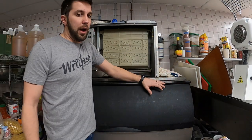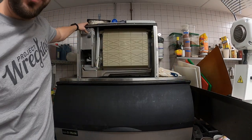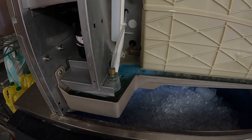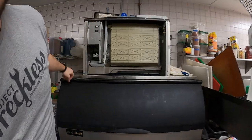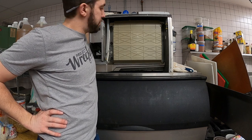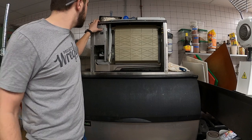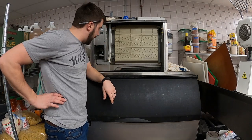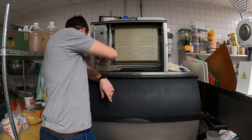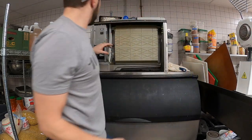So now your next step, guys, is you're gonna turn your water back on. We're gonna purge this cleaner out of here. You can see, I'm pretty sure they tinted it green so that you know when you're completely cleaned out. So I'm gonna sit there and purge that out. You'll hear that pump working, that's it cycling out all the water. I stopped the purge, I'm gonna let this fill one more time. Water's gonna go back off now, guys. I'm gonna turn the unit to off here.